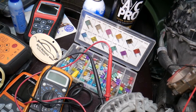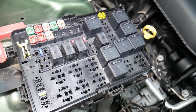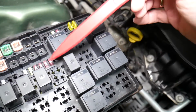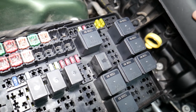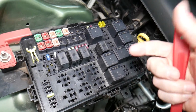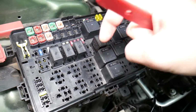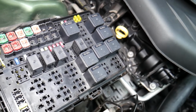Before we continue, let's explain quickly why it's always a good idea to test fuses and relays. It is super important, guys, to always test fuses and relays, and something else as well, common mistakes people make. Sometimes you may think that a fuse is good, or you cannot actually see if the fuse is clearly burned, and in that case, guys, you may end up spending money and time on parts you don't need, and all we had to do is just test the fuse. We'll put a link in the description of the video below on how to test the fuse. It takes only a few seconds to find out for sure if it's good or bad.